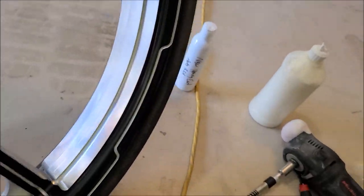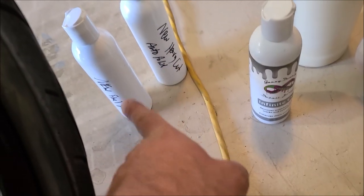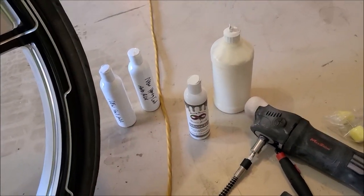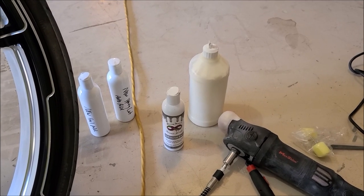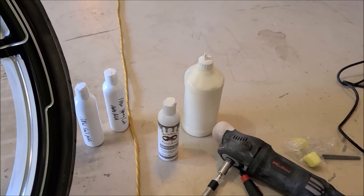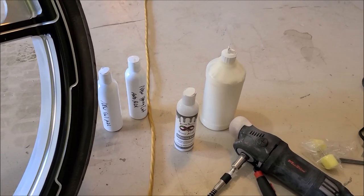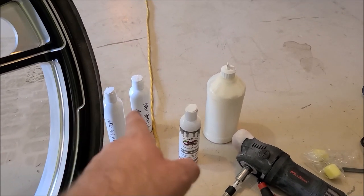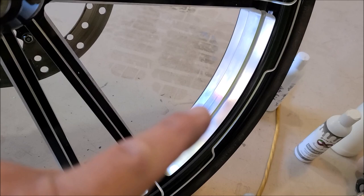With all that pitting, I'm just doing some testing. I've been using a combination of a few things: the 2021 Heavy Cut with Smart Tempered Abrasives, the new 2021 Smart Finish, Infinite Cut, and the new sanding polish going to the Marine line — that's like sanding with 500 grit sandpaper, but you're polishing. It does not finish amazing on its own, but it finishes amazingly when you follow it with a finishing polish like the Gel Coat Finishing Polish or the new Smart Final Finish. The reason I'm not using the sanding polish right now is it was leaving too many scratches that I didn't want to have to remove in this soft, bare aluminum.